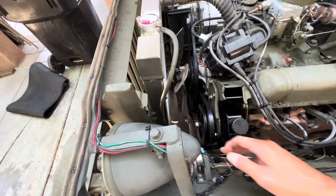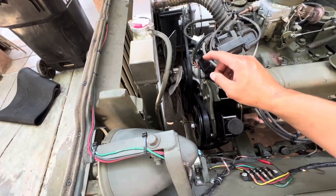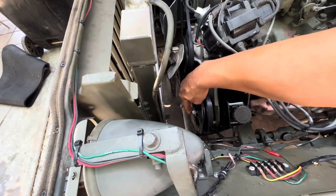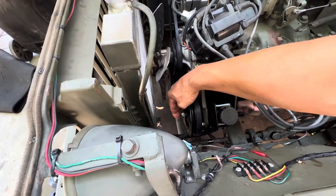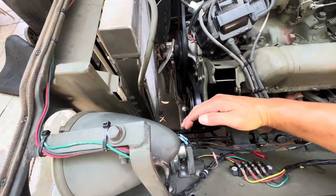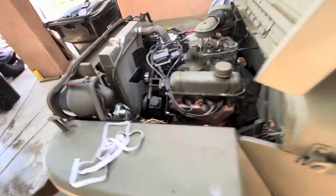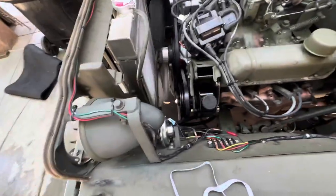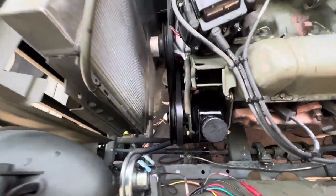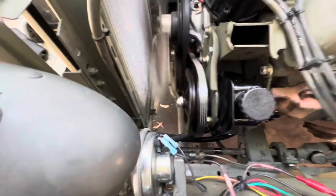Looks pretty down there. I did order another one that's supposed to be specifically for Buick, supposed to be in today sometime. When that comes, I'm gonna pop that thing on there, and if it wiggles, then I'm not suspecting the pulley no more. I'm gonna suspect this rod here, because when it was shipped in a box, I was already suspicious because it looked like the box was hitting there. So that shaft might be bent, making this pulley do the wiggles. But it does work. See how it wiggles. And as I increase the RPM, it kind of goes away.